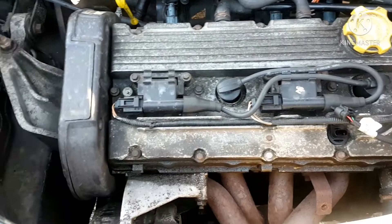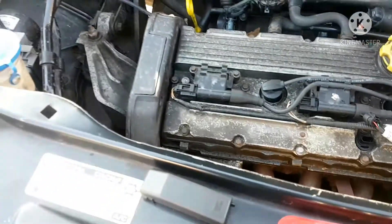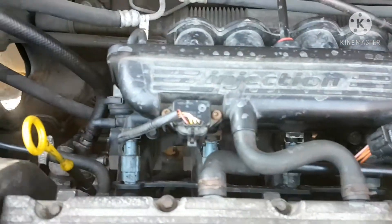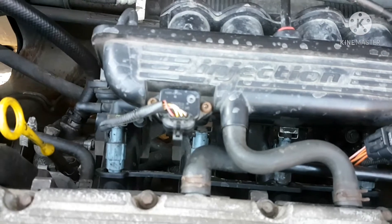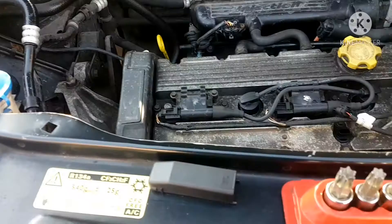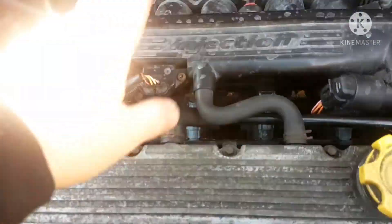The plugs were done just recently. Before I did that, I confirmed that the coils and everything are fine, so that's not a fault. I've also checked all the injectors — I've actually pulled them out, checked the resistance, physically checked them, made sure the spray pattern is fine. That's good. I've also checked my manifold air pressure sensor. That's fine.